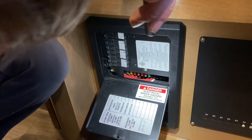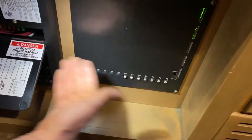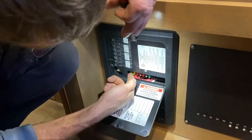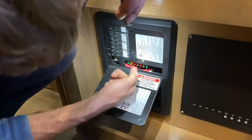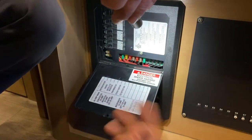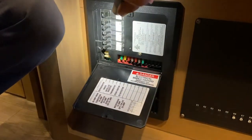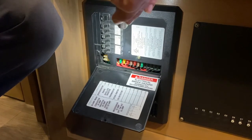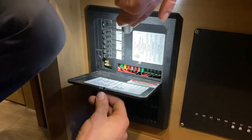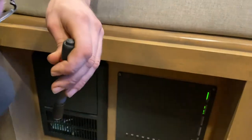These are your 12-volt fuses. You have some 12-volt breakers here too — those are resettable, just push a button. The fuses are not resettable; you'll have to replace them if they blow. Get a variety pack of automotive blade-type fuses — some 30s, 10s, a 20, and some 5s. If any breaker or fuse trips and as soon as you reset it trips again, it's obviously not the breaker or fuse — you've got another problem and will need to get it worked on.